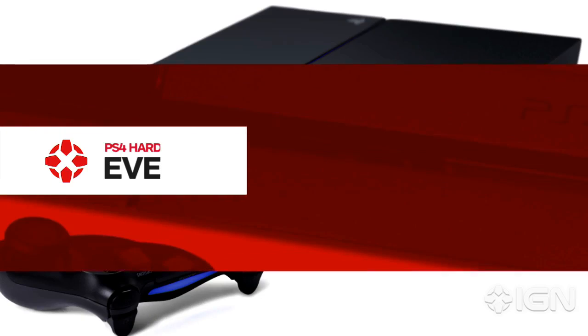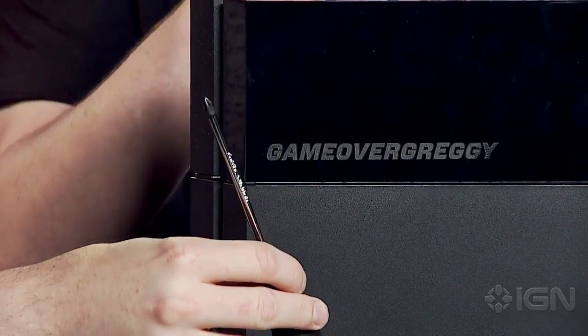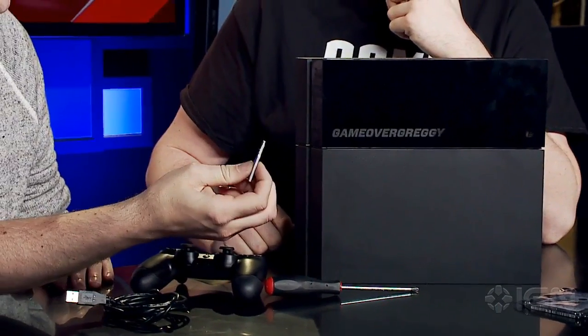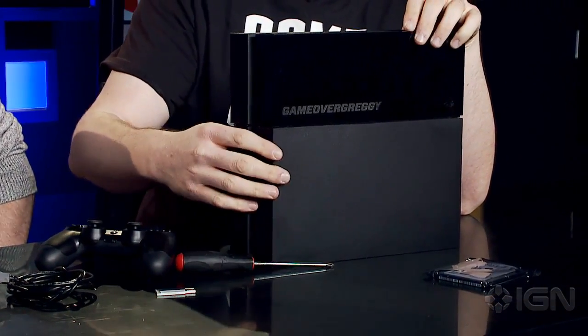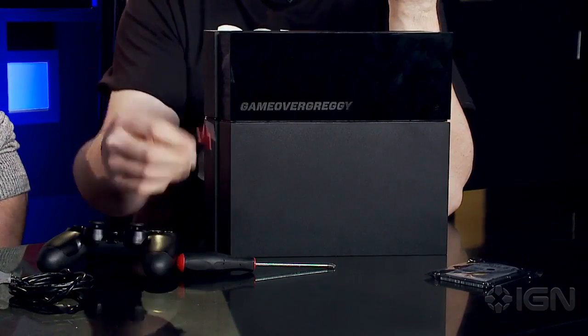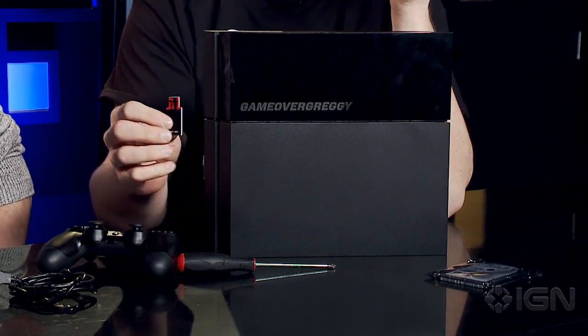So Scott, real quick, let's run through everything we'll need to swap out a PlayStation 4 hard drive. What you've got here, of course, is a Phillips screwdriver, the cross one that makes an X. You've got a thumb drive. It should be at least a gig, preferably more. Make sure it's thin enough to get through the crevices here. On the thumb drive, of course, is the latest PlayStation 4 firmware. You can get this by Googling PlayStation firmware. They'll walk you through how to put it on.